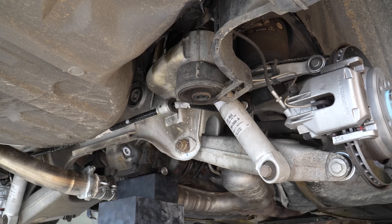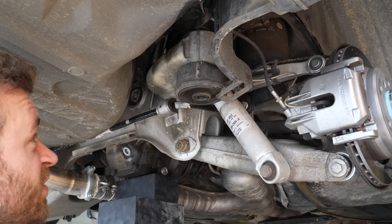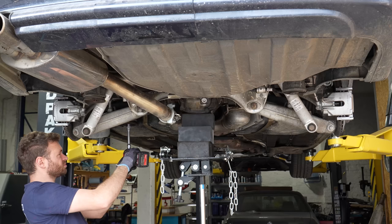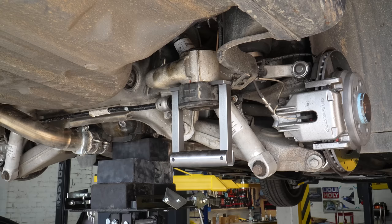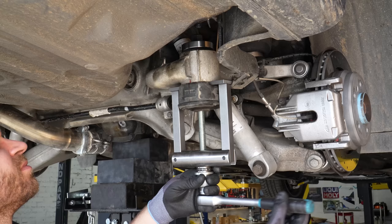A lot of you told me something I didn't know: the subframe bushings on the E39 Touring wear out quicker than the E39 sedan. I've never done them before because I've never owned a Touring. I can see some cracks in the rubber. First we're going to mark the position of the bushing. This is the rear subframe bushing tool specific for the E39 Touring — I got it from eBay, same seller I got the tool for the Alpina E65. I'll leave the link in the description because the quality of the tools is really good.